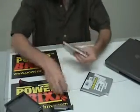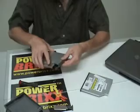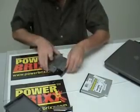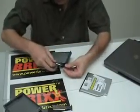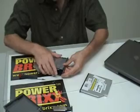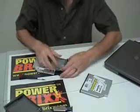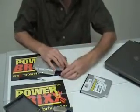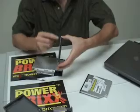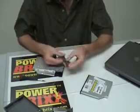This was the Dell drive. I'm going to eject the drive mechanism here. What I need to do is remove the bezel. I'll take my Husky screwdriver and apply a little bit of pressure to open up a slot to allow the bezel to come off. Then I just roll it off — work it out a little bit, bending it just slightly as I pull it out. It releases the hooks that hook onto plastic anchors on the inside of the drive plate. This is what's really important.